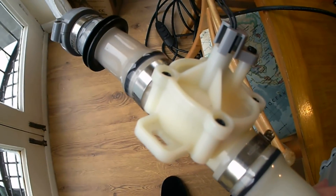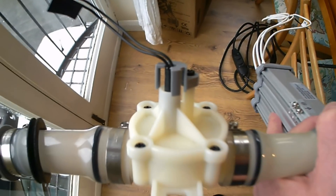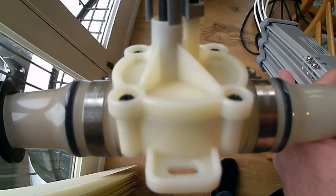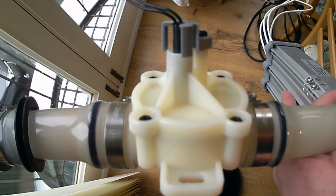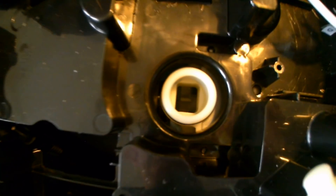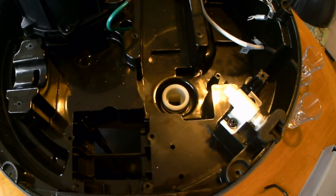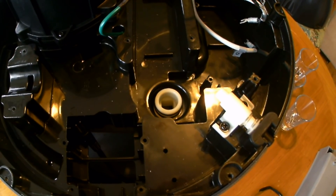I've now screwed that back in position. Incidentally, I've seen this little unit on eBay for about £25 — don't do it, because it's just £10 for that little sensor that goes in the top. Next we'll be moving on to looking down here. There's a little hole, and down at the bottom of that is your impeller, which is potentially the next point of blockage — and I think that's what's wrong with this one, although I'm not 100% sure yet.